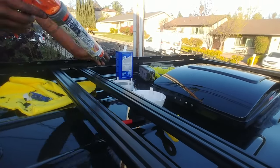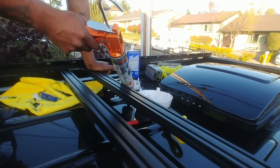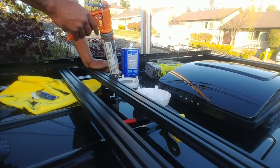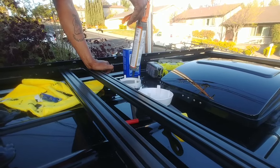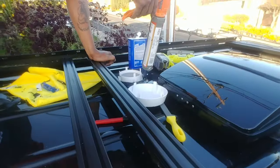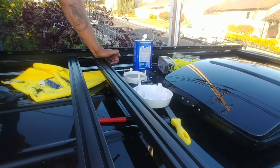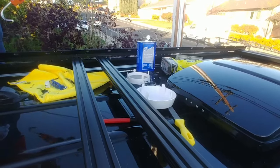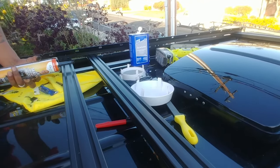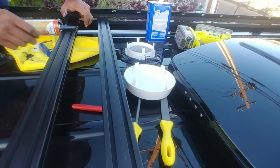For the last step with the fan before we finish up connections and the trim pieces downstairs, we're going to apply some lap sealant. Be generous — make sure you get the top of every single screw hole and make sure there's no chance water is going to get in. It's better to be a little more generous than not enough. This is going to be underneath the solar panels, so I'd have to do a lot of work just to get access to this — please take your time with that.